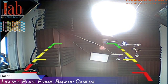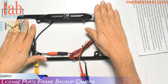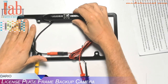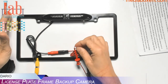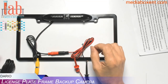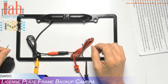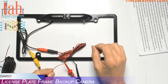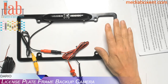It's a good choice. It's a frame because it's easy to install. You have nice night vision, eight LEDs, 170 degrees, and you can also adjust the angle. Pretty simple install — you're going to put this into the reverse light, put this to the ground, and if you have the trigger wire, hook it up to the pink wire on your stereo, and this one goes right into the camera. If you need more information on the license plate frame backup camera, check the link below.